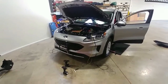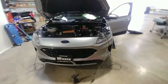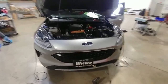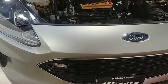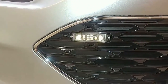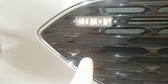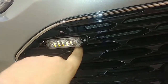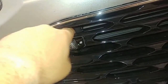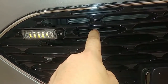Just a quick bit of detail on these grille lights. These are LIN-6s, but you could probably also do this with a TIR-3 or a SoundOff M-Power — I think they'd fit in the same area. Here's our final product: the light is mounted right there in one of the solid grille areas. You go just to the left of the rubber here and tuck the rubber back — that gets you out from behind the active shutters.